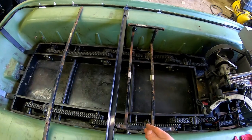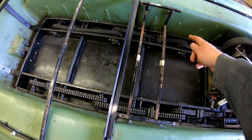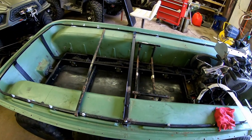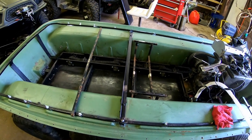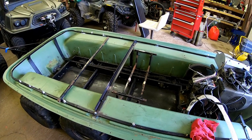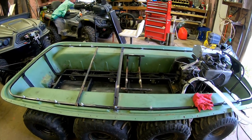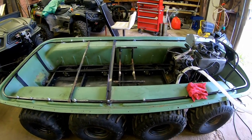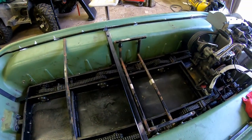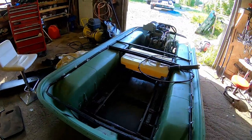I've got my seat bracket in place. I just need to line it up the best I can and tack it around the outside perimeter on each leg, then attach it to the cross bar as well. After it's tacked in, I'm going to fit the empty gas tank in place to make sure everything fits nicely. That'll have the seat conversion done, which is going to be a lot more comfortable and will definitely help prevent flex on the tub.